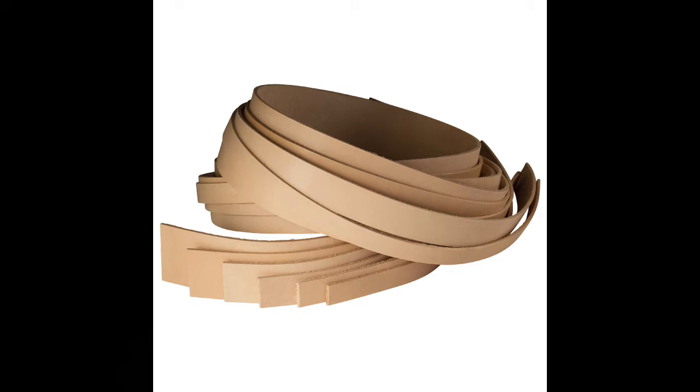But the metal ones actually did as well. You'd be surprised. With some of the early drum brakes and some of the earlier transmission bands that were made of stainless steel, you get steel hot enough, it's going to get brittle and snap and catch fire and catch everything else around it on fire. That's again why they didn't last as long and why they weren't in use much past about 1910 or so. Unless you're talking about a Model T's bands, but even those were hybrid bands and often did use asbestos as well.